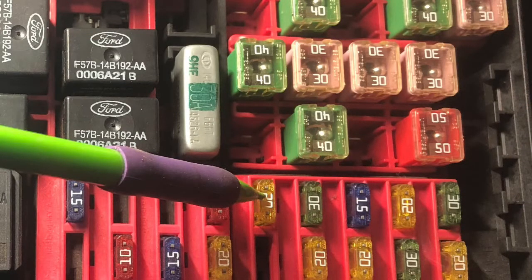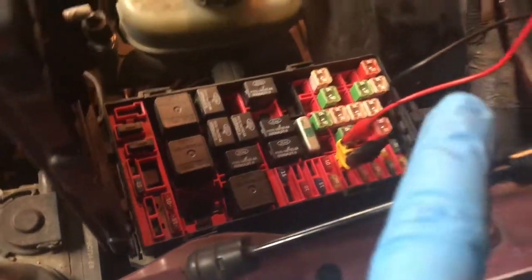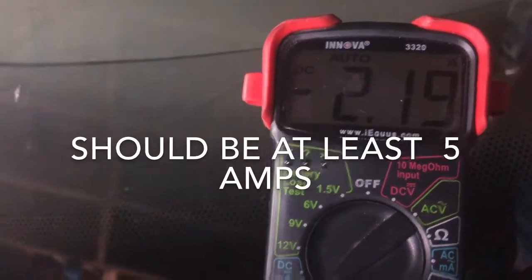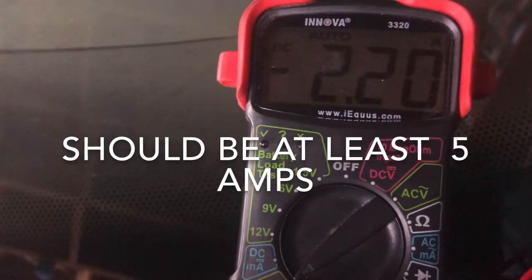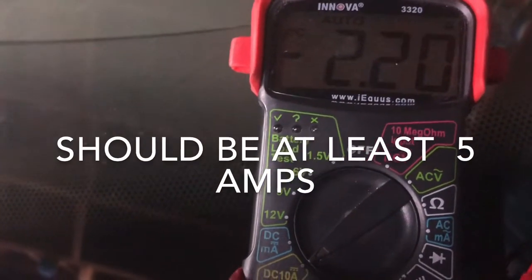This is the fuse that powers my fuel pump — it's a 20 amp fuse. Now that we've got that identified, let's remove it and do some testing. I put a special connector in there that allows me to put my multimeter in series with the fuel pump circuit. And I'm drawing two amps. That's the low amperage for this fuel pump circuit. At this point I'm suspecting I've got a weak pump, but in order to be certain I need to check the power and ground feeds to the pump before we call it a weak fuel pump.